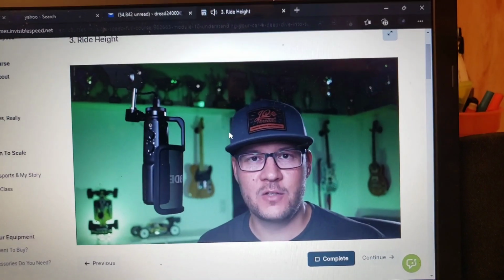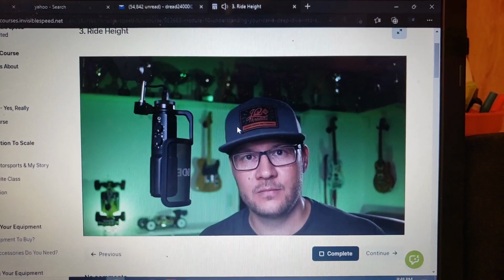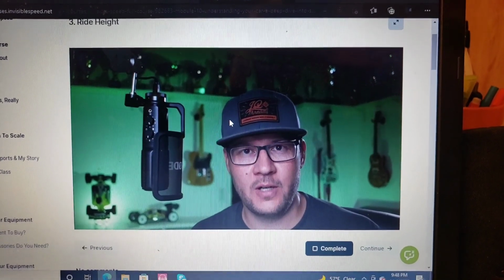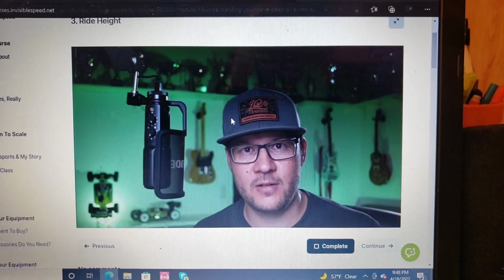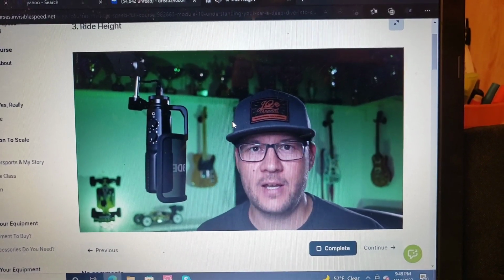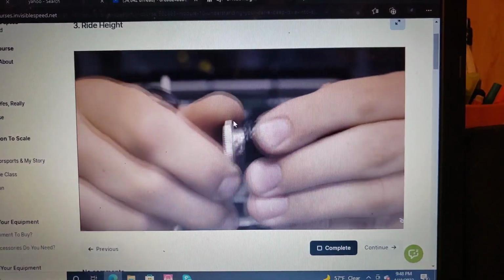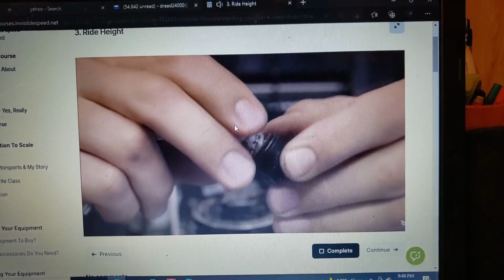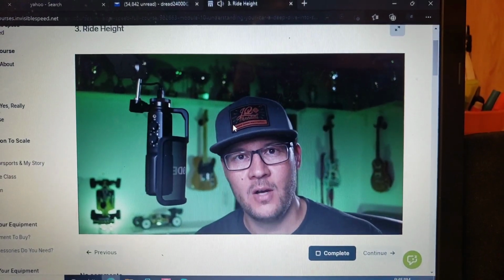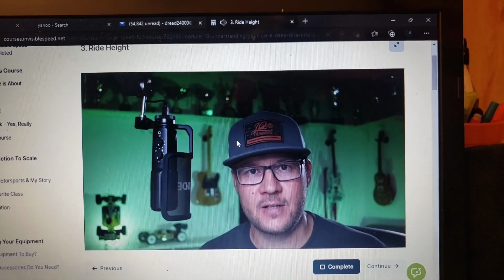There are various different tools on the market to measure ride height. The simplest is just to use a steel ruler or your calipers. The steel ruler is good for a lot of other things too that you adjust on the car, so it's a good investment. But in my opinion, by far the best ride height gauge is GEA, Swedish innovation. Really simple, 1 mil clicks, and you can adjust it from between 20 to 30 millimeters with the same tool. Or you can have an extension foot to get higher, or he also makes different sizes.